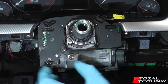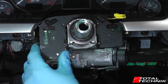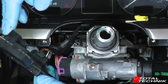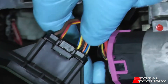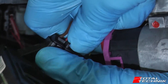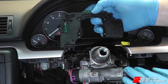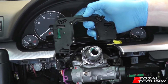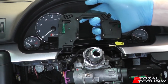The other thing we need to do is disconnect a larger electrical connection on the back inner side. I'm just going to very gently lift that up and twist it around — you'll get a good view of the electrical connection on the back. There's the usual compression tab, so just pull that down and pull the whole thing forward. So as you can see, there is quite a lot of stripped-down work to get to this stage, but actually removing the steering wheel control module itself is fairly straightforward — and that is your steering wheel control module completely removed and good to go.